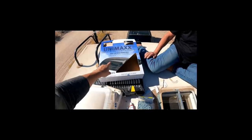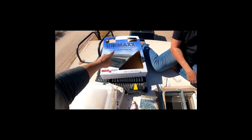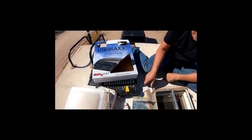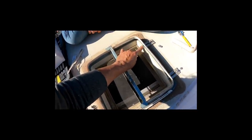I bought this vent lid from one of the RV shops and they said it would fit because one lid fits all — it's supposed to be universal. Guess what? It doesn't. So I'm going to have to go to the RV shop and get a different one. But before I do that — see, they just had these self-tapping screws which wiggle themselves loose, that's the problem. So I'm bolting it in. I've got these bolts already, one's already done, three more to go, and then I'm going to tighten them up.